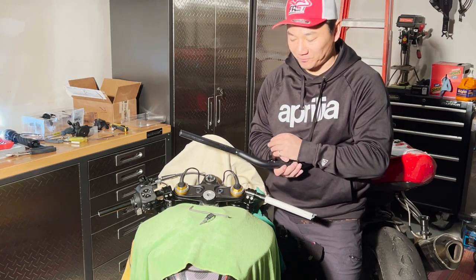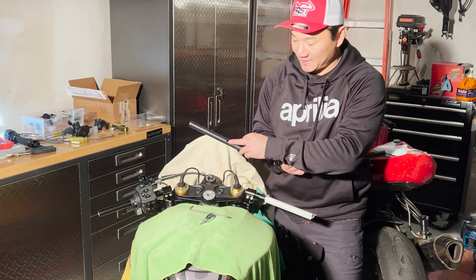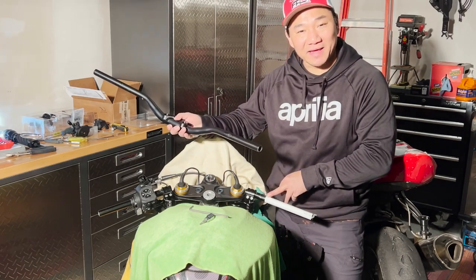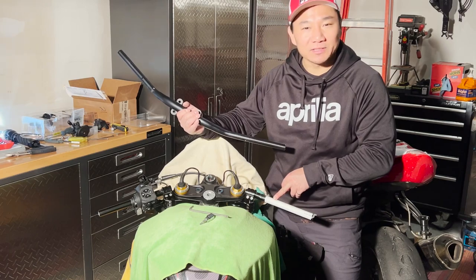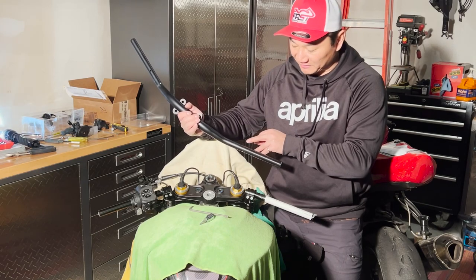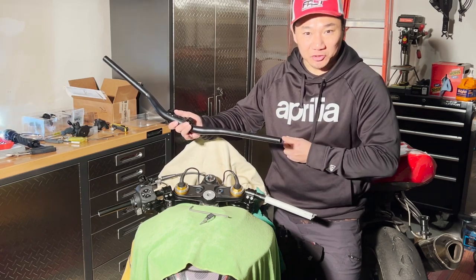But guess what? This bigger hole where I thought it was the M5 by 0.8, it's not even needed. Okay, and I'll explain why. And remember I said on the right hand side that I need to drill another hole? Well, you don't need to. There's only one, and that's exactly it, the M4 by 0.7. So that is good for the throttle control.